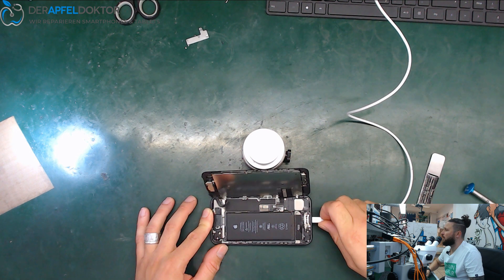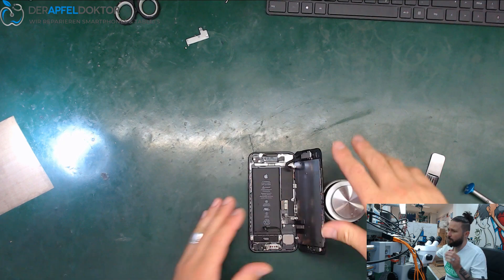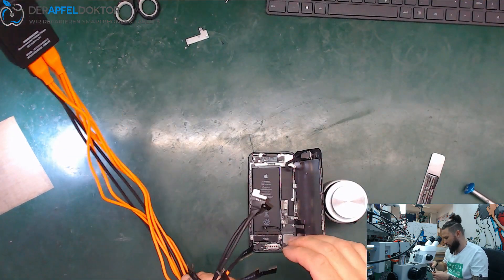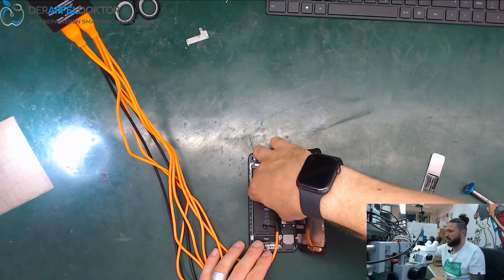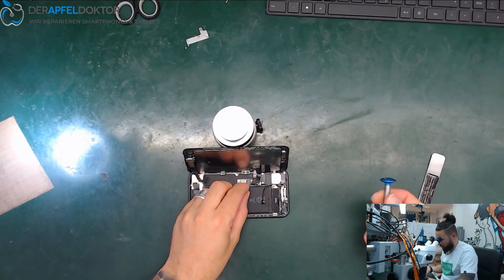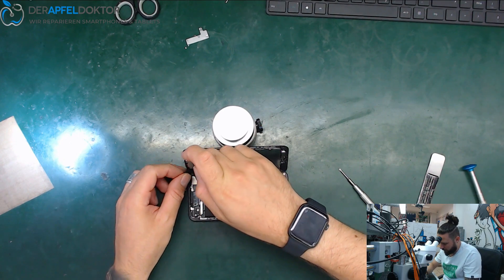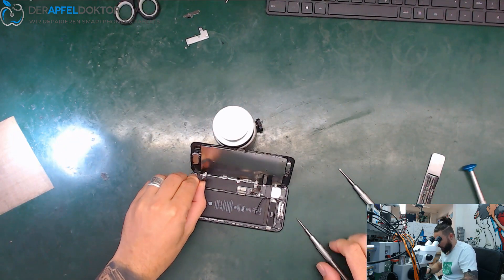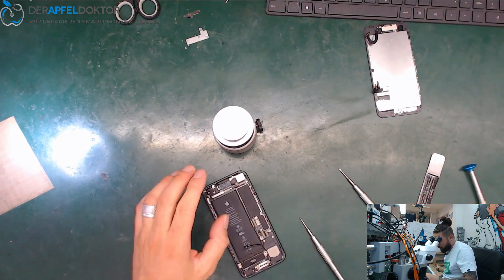When I plug in the USB amp meter I get zero. When I plug off the battery, get my power supply, and get my cable hooked on, we got a VDD main short. So I can't try to boot that device because we are shorted. Let's move away the short, and then let's see if the device wants to charge, because it was charged at 24 volts and often after that you need to renew the Tristar.